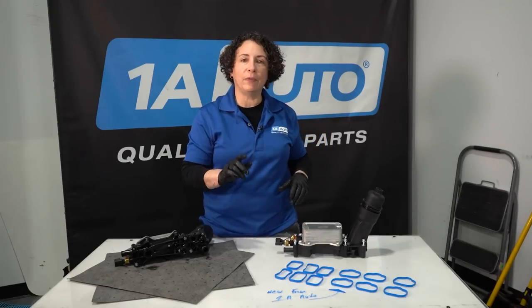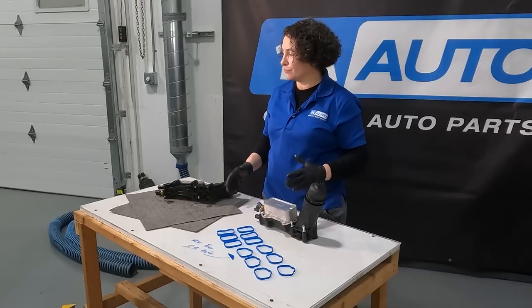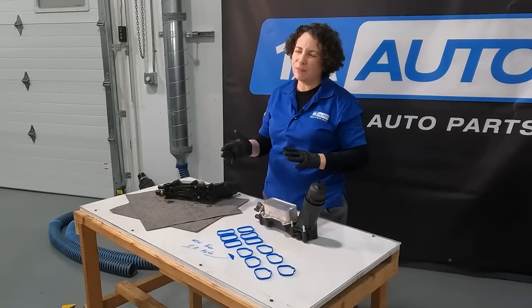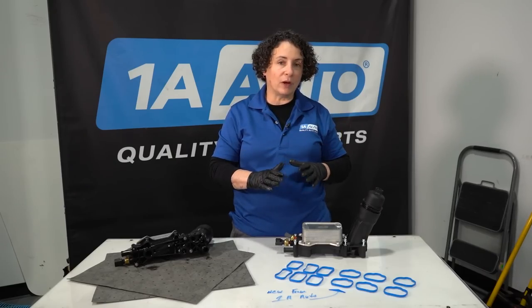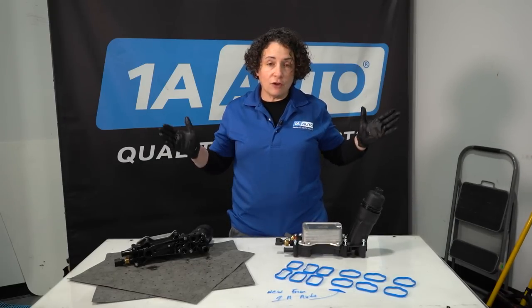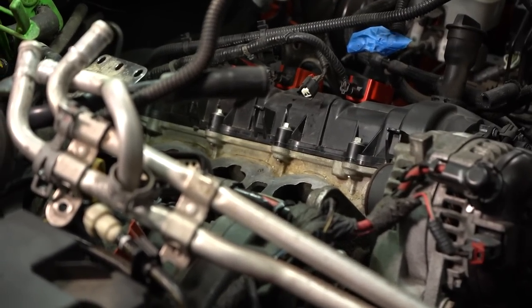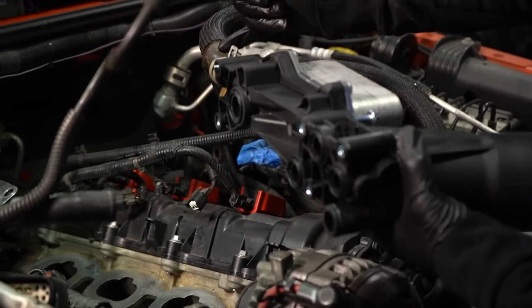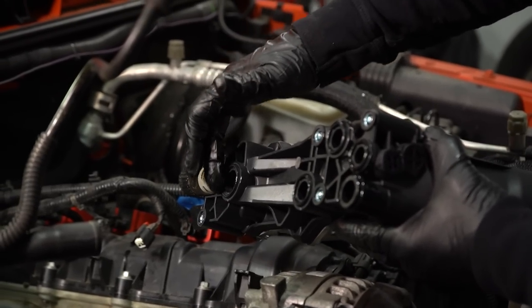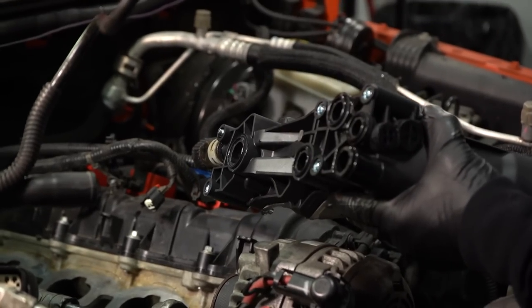You have to clean that mess up — wipe it down, make sure there's no debris around, then install the new housing. This job calls for about a three to three-and-a-half hour job and we have videos on our website to show you step by step. It comes with the upper and lower intake gaskets — you don't even have to do anything else, just get oil and you're ready to go. I'm going to put the oil filter housing down in there, get the hose back on, and put fresh oil on the O-rings. They don't have to be doused in it — just enough to make a nice seal connection.